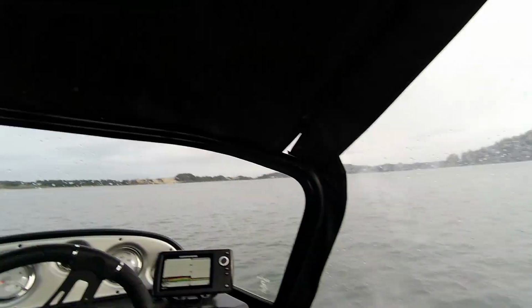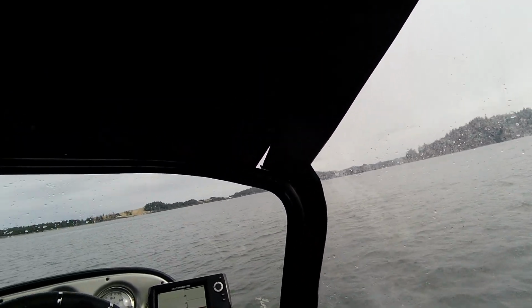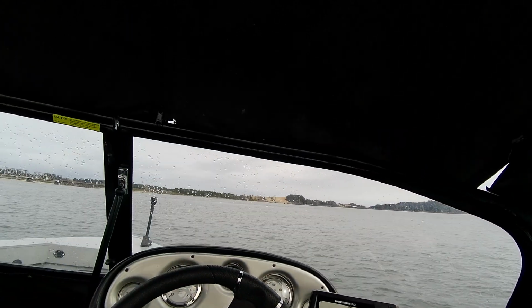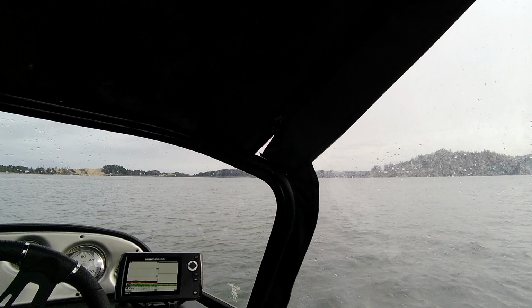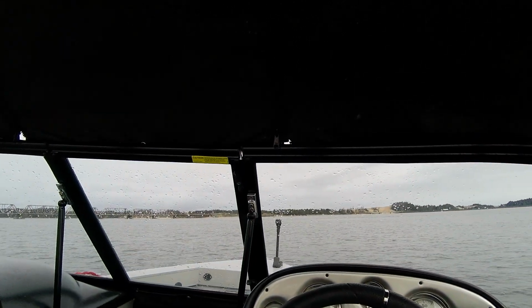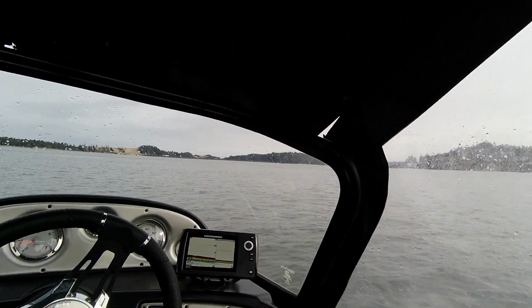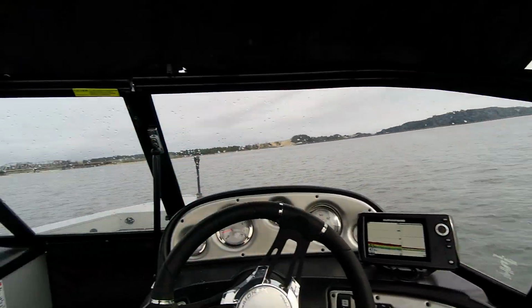And this is where it mostly happens. Say you're loading it on the trailer. You're going like this to raise the motor up a little bit. Then you get it up and you bring it back. So you like to hear, right? You trim it back down again. Now I'm going to do it, of course. When I got up there and then brought it back, now you hear the click, right? But see, I just brought it back to here and didn't hear that click. Then I went out and turned the key.